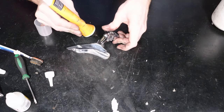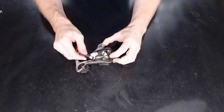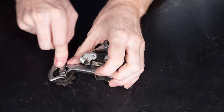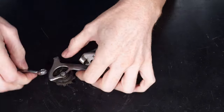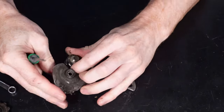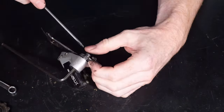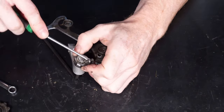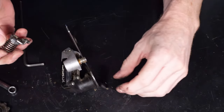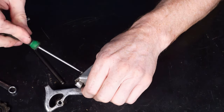So with them, I just sanded them all down, which wasn't too bad. They were a little bit sort of scabby with rust. So I sanded them down as best I could without going too mad where the GT logos are, because they're actually pressed into the handlebars. If you sand that down too much, you'll end up losing that. So luckily I could get rid of all the grubbiness and the rust and everything around that area without sanding them down too much. Then I just gave them a couple of coats of primer, nibbed that down a bit, bit of wet and dry, and then painted them with a nice coat of black to give them the original finish.